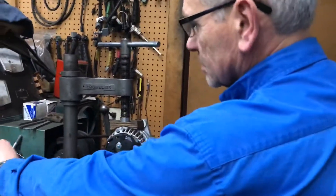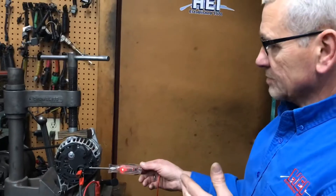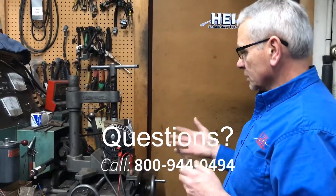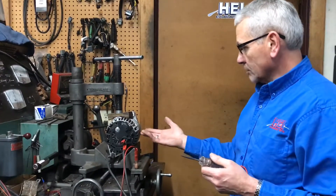That's putting a load on the alternator and it's still not heating up at all. Some of the problems with these alternators is because they're a dual battery system — sometimes there can be a cable compromise or connection issue, and the alternator searches where to set the voltage because of a dirty cable or bad connection. But absolutely nothing wrong with this.